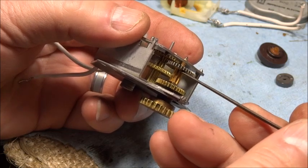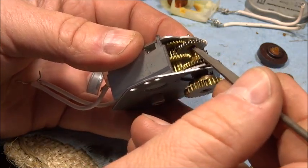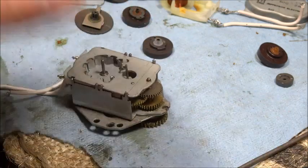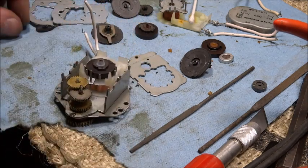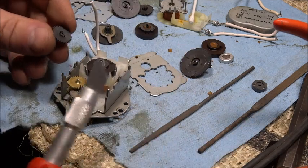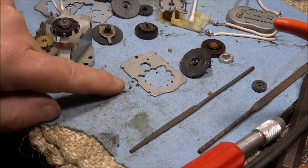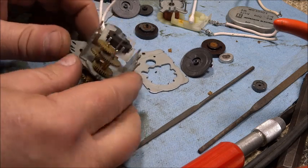And it looks like that's where it likes to ride, because all these teeth are mangled up in here. So I need to just make a small spacer to fit right there. So I made this little gear, this little spacer. I just took one of these spare plastic gears, and I took an X-Acto knife and I whacked off a little piece of it and sanded it down, cut off all the little teeth,